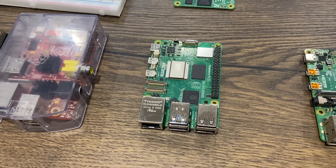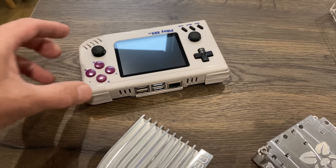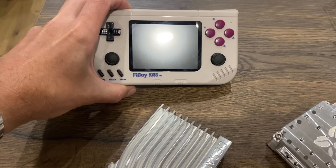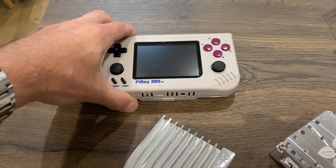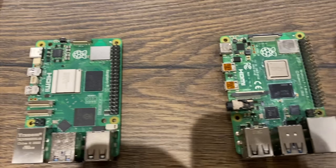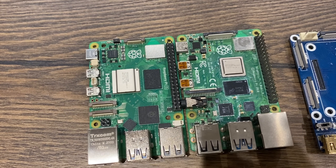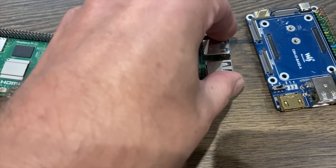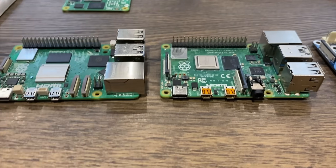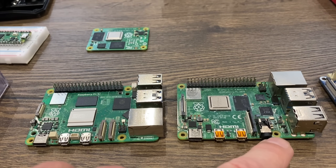So what cases are going to fit the Raspberry Pi 5, now that the Ethernet connection is on the other side? I've already done a video on the Raspad — a Raspberry Pi tablet — and it actually works fine. We probably won't have as much success with the Pi-Boy, though. Because the heat sink touches the CPU, and the CPU on the Raspberry Pi 4 is in a different position to the Raspberry Pi 5. We've also lost the 3.5mm jack, so adapters that use that will either need to be adapted or won't be usable.